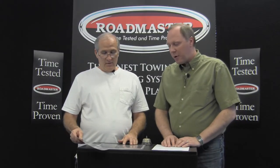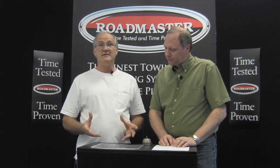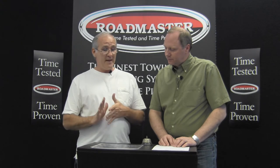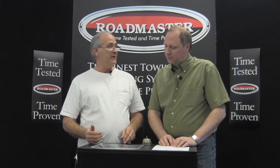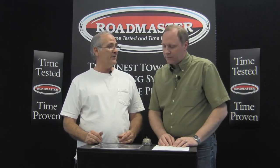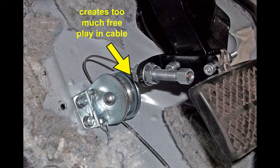Next item, still on the pulley: the pulley is mispositioned. One of the things we're trying to do is pull on that brake pedal, and we need that brake pedal to function normally as if there wasn't a braking system there. After all, this is an InvisiBrake. You don't want that pulley coming into contact with your brake pedal. With proper location, the pedal bracket will actually clear the top of the pulley, missing it, and you can still get the appropriate angles while remaining straight. In this particular photo, the problem is that the brake pedal can't be depressed normally because the bracketry installed on the brake pedal is actually hitting the pulley.